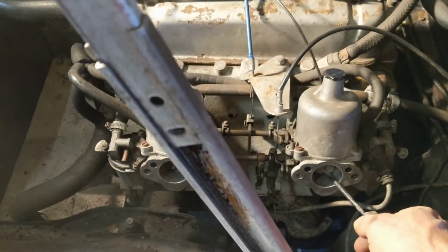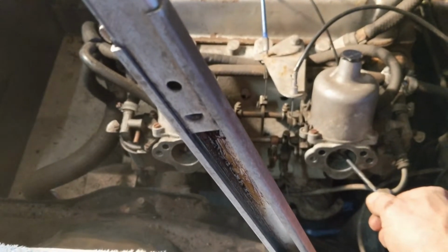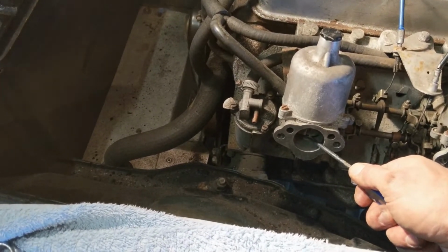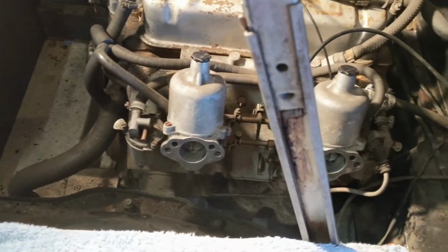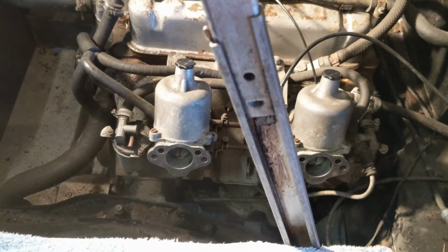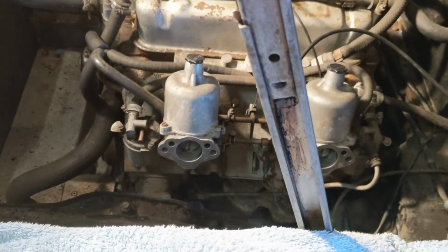So when I lift this, we see it, and then it flattens out again. So I don't know if that's a bit too much. But same on this side. So we get a slight quickening, and then it seems to hold there, irrespective of how high I lift it, which I think is what I want. So I'm now going to use Colortune to see what it looks like on the other side.